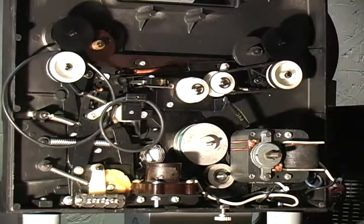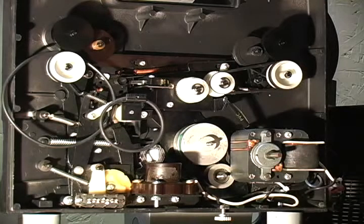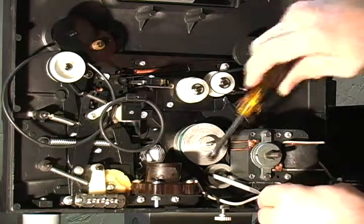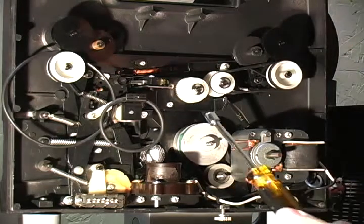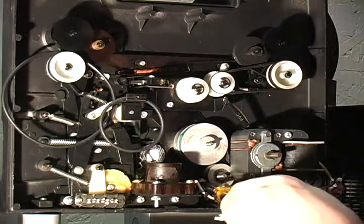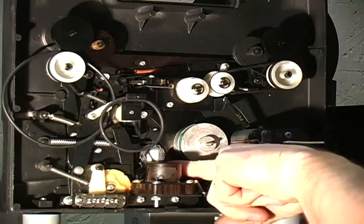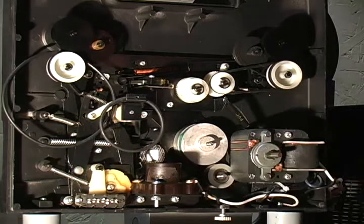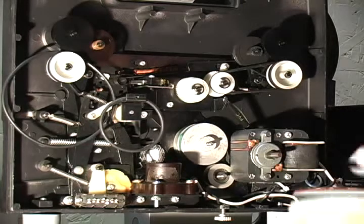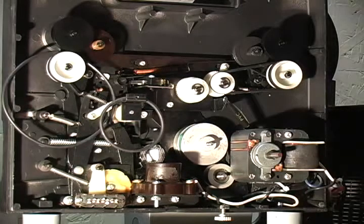Now, if you get your belt on and you notice that the belt is either too tight or not tight enough, you can adjust that. There's a little hex head right down in there, and all you do is take your little hex head quarter-inch driver, put it in there, and turn counterclockwise to loosen it. Then take your finger on this side and this side and flex it — it will actually expand, or it can contract the other way. There is some adjustability there.